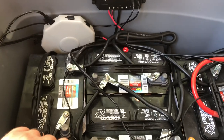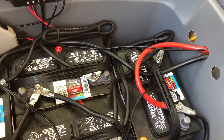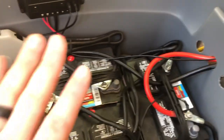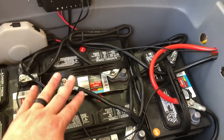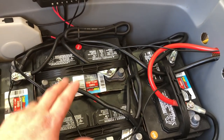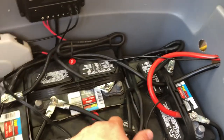I need to get an inline 200-amp fuse put on here in between my batteries and my power inverter — I know that. It's just been real hard with my work schedule and trying to find that stuff locally at stores. So I'm going to get on Amazon and order the 200-amp ANL inline fuse and mount it in between my batteries and my power inverter.